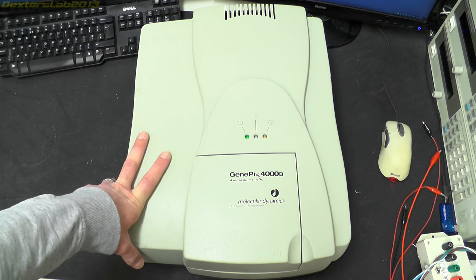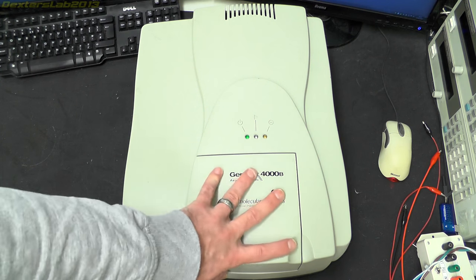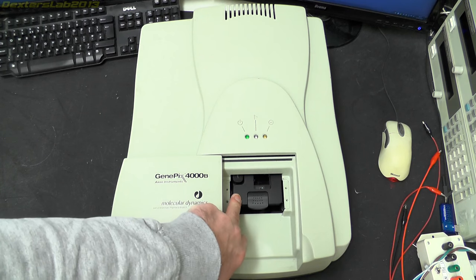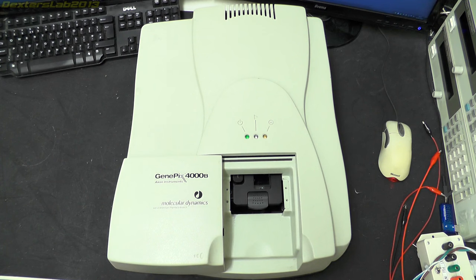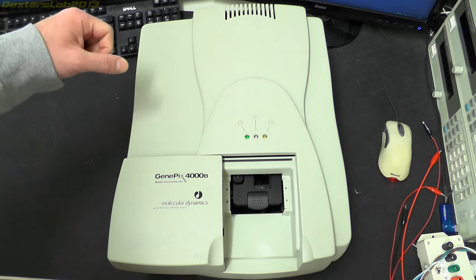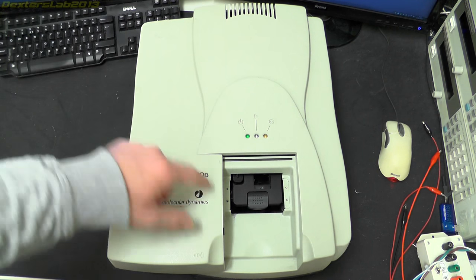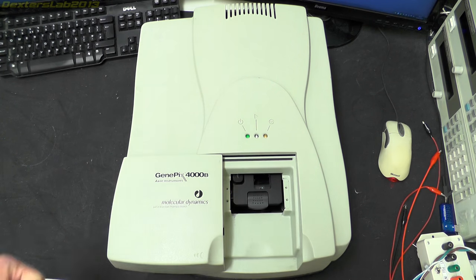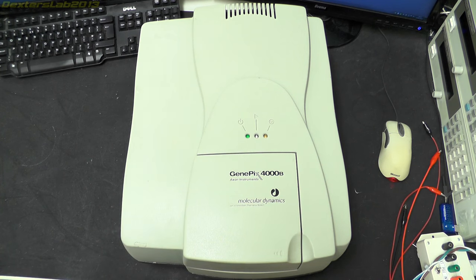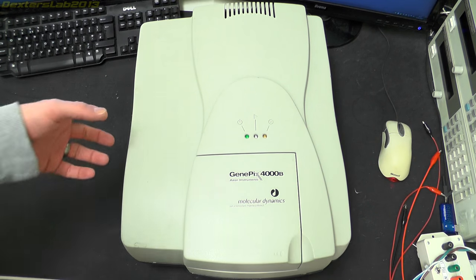When I first picked this item up I wanted to try and get it working. To take the lid off there's just four screws right on the base, but when I took those out I actually couldn't get the lid off because the loading tray was all the way out, making it physically impossible. I was cursing and swearing at it for a good while, and then I realised that if you open up the back I could just manage to tilt it forward a little bit and get my finger inside and actually turn the stepper motor from the back, which allowed me to move the tray very slowly backwards to allow me to take the lid off. Presumably in the software there's probably some option to set the tray in or out for servicing.